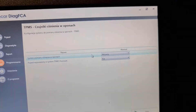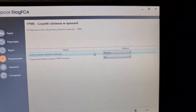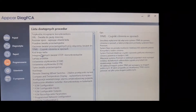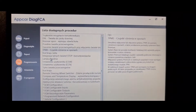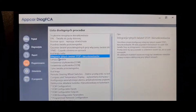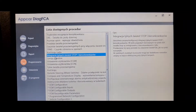And here if one of your TPMS sensors doesn't work and you have that dashboard warning light, you can deactivate it so it doesn't disturb you. You can do changes here. Radio nationality code — integration stoplight and blinkers — that function you can choose when you bought a US car and swap the lights for a European car, so you can do changes here.